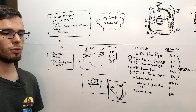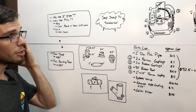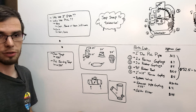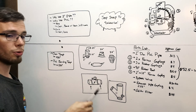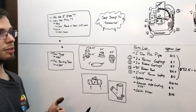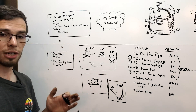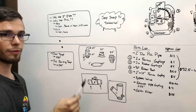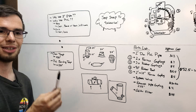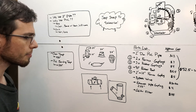The air inlet temperature sensor modification deserves attention. In the factory location on the intake manifold — right above the exhaust manifold — the sensor is prone to heat soak, causing it to read warmer than actual inlet air temperature and leaning out the engine. After a long drive on a hot day you'll notice the Jeep gets sluggish. By moving the sensor to the Y-pipe, it reads ambient air temperature, slightly colder than what actually enters the cylinder, causing the computer to add a little more fuel — which is a nice advantage when running a supercharger.